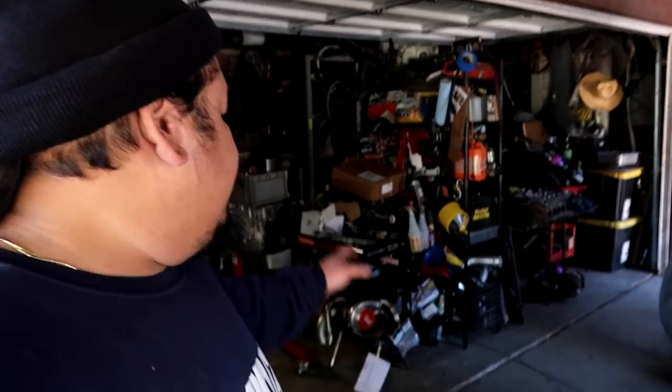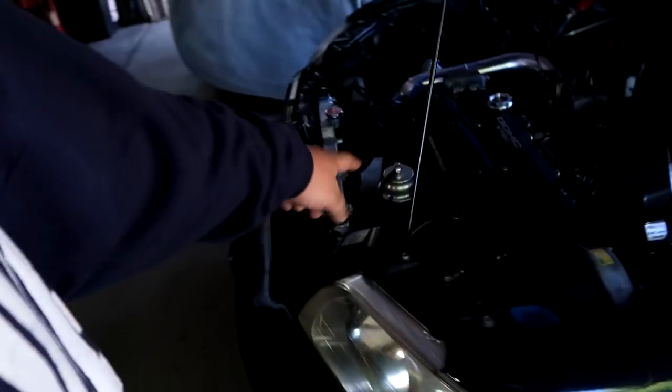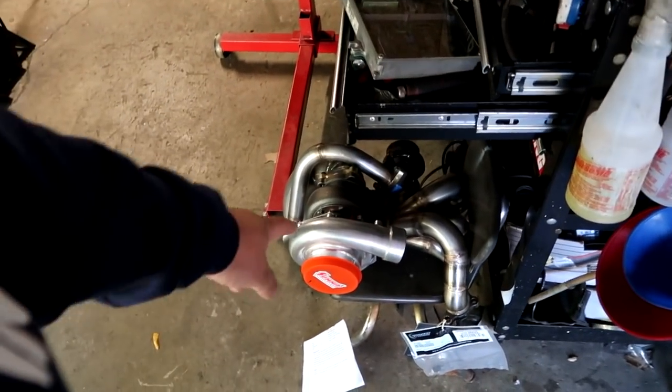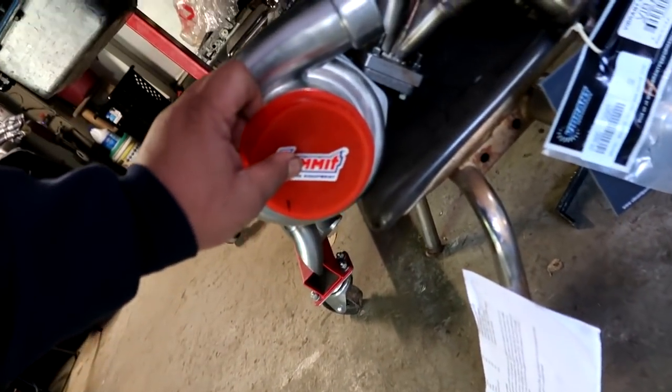But his first setup let go probably a month or two ago, and now we have a sleeved LS block, piston, rod, LS VTEC, and today we're gonna upgrade the turbo kit from the eBay 57 trim with a log manifold to a Spoolin Performance mini ram with a GTX3582R.